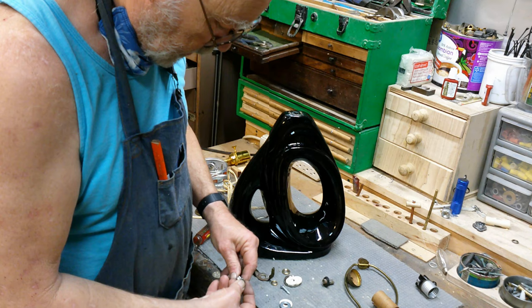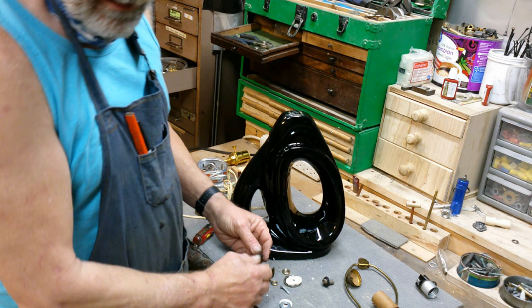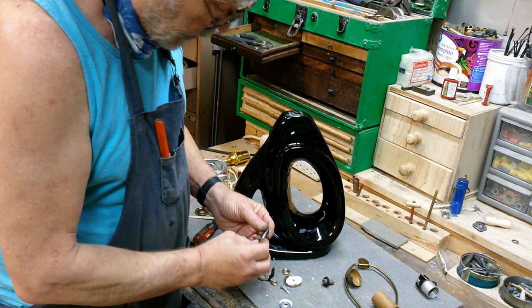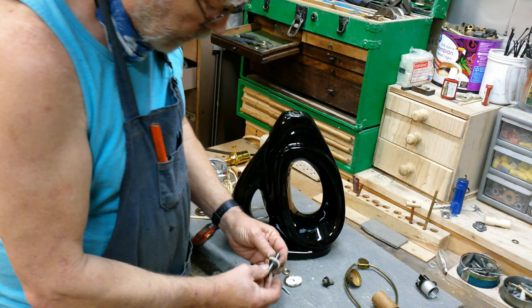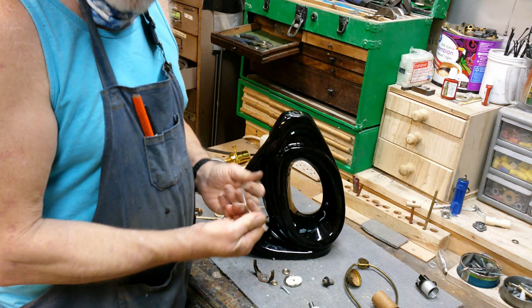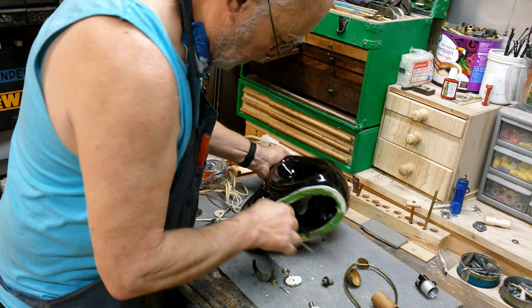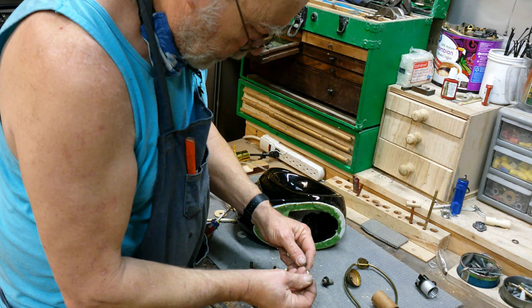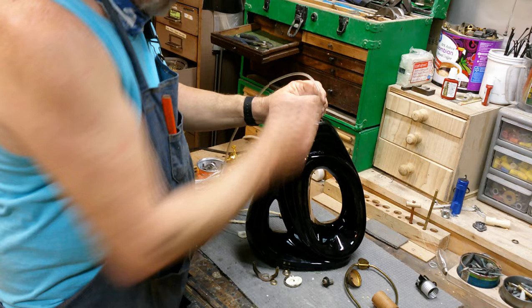I'm going to have more cushioning on the inside as well as on the top. One of the problems with ceramic lamps is that you really can't tighten them down as tight as you'd like to, because you've got the chance of breaking the lamp. And that leaves you with a lamp that's likely to come loose and wiggle a little bit — it gets turned, and then when people start trying to put it back together, they turn it the other way, and all that does is just twist the wire up and makes a big mess. So to get this wire and this pipe back up in here, I've got a piece of aquarium tubing. Pull it out, stick it through the pipe, put a wood screw in the end here, and pull it out real nice.